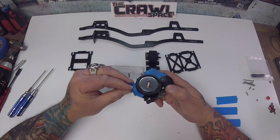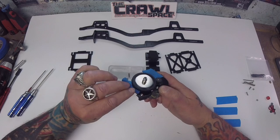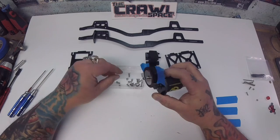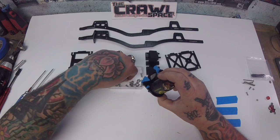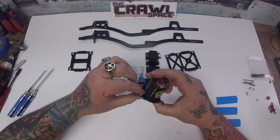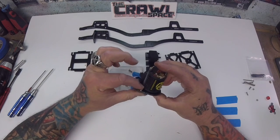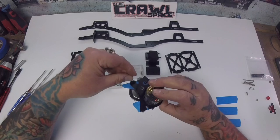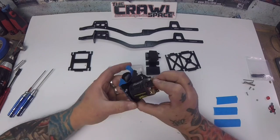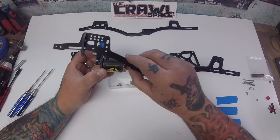On the spur side I'm going to tuck this in there just a little bit, press down on it and fold it back so it doesn't get caught in the chassis while I'm assembling this motor plate to the chassis rails. Drop our nuts into our T-slots, pressing firmly so the tape grabs a hold of it. Now this guy is ready to get installed into the chassis rail.